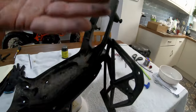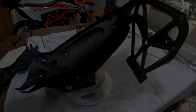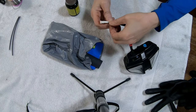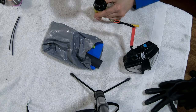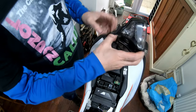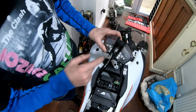So 774 grams for all the plastic bits that have come off — that doesn't include the bolts, there are a few bolts as well. So roughly the weight's about the same but there's so much less leverage. So having checked the bridge between the white and the green wire, soldered it and I'm going to seal it with some liquid tape — stage one of the protection. I'm waiting for that to fully dry. Let's just test it and see if that number plate light comes on. So what I'm looking for is a light there which wasn't there before.